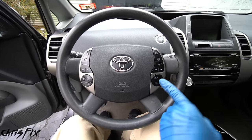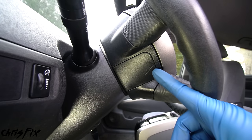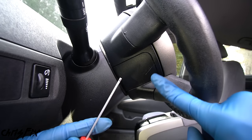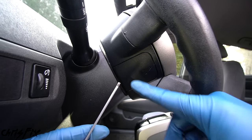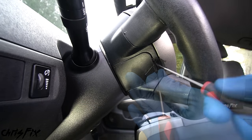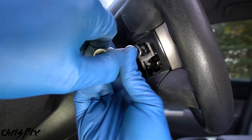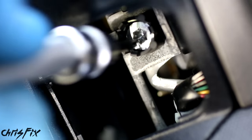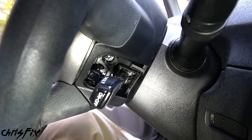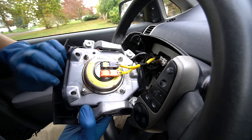After 15 minutes the airbag is safe to remove. There's a screw on each side of the steering wheel holding it in. Move to the side of the wheel, use a flathead screwdriver — tip it with electrical tape to avoid damage like someone did here previously. Pop the plastic trim out to access the Torx bolt and break it loose. Note these bolts are held in by a plastic retainer so they don't fall out. Do the same on the other side, then the airbag is free.